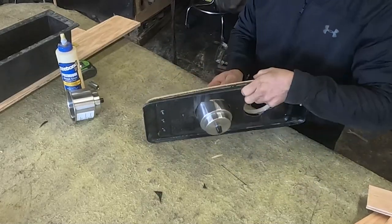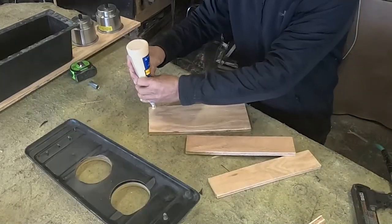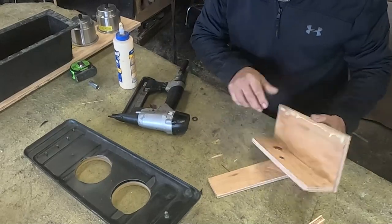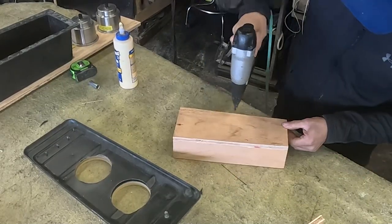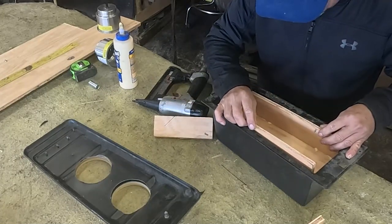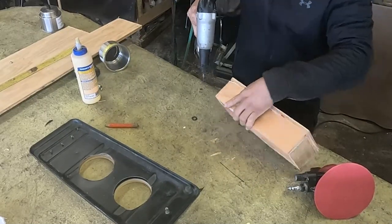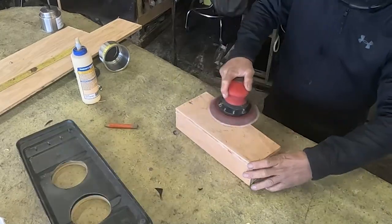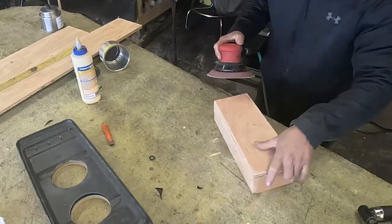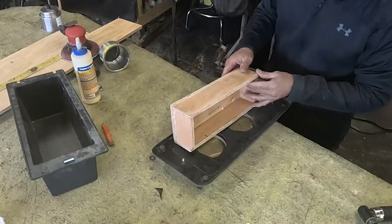The customer doesn't want to see those cup holders from inside, and I understand — me neither. So I will make a box so those cup holders will be inside of it. I cut some pieces of wood, add wood glue, and put some staples, and you can start having an idea how that will look. I'm using this wood, and all that wood will be wrapped with trunk lining material. It's kind of loose but keep in mind that wrapping with material will increase the size a little bit. I put the other front and back small pieces with staples, then get the pneumatic grinder and sand all those sharp edges to make them nice and smooth.